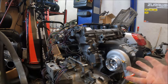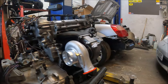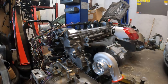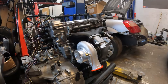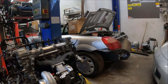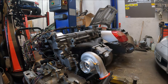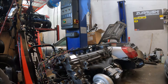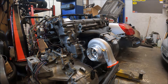So if you look at dyno results and you've turned up the boost but your peak power maximum RPM has gone down a lot, you're probably running out of turbine. But on this car, running only about half a bar of boost, that turbine is not a problem — you'll guarantee peak power is the same as a standard VR6 if not more. Anyway, hope you liked that little short tech video. I'll get back to the MR2 early next week — this is Sunday and I'm just quitting for today because I broke something. Hopefully you'll see more soon because I've made some rather interesting changes that I've never mentioned. See you next time.